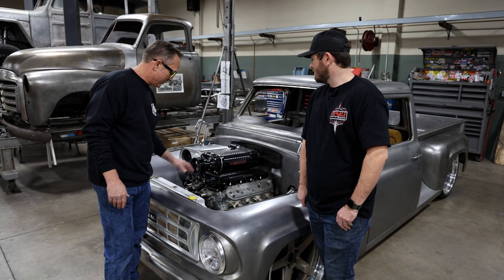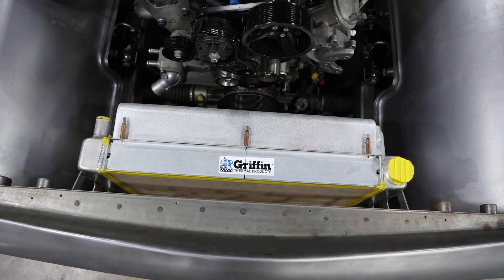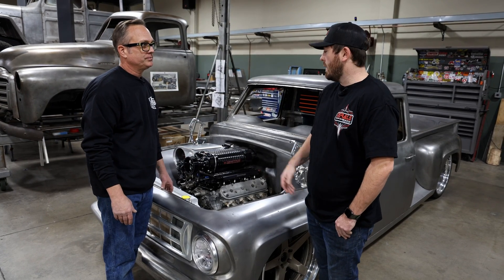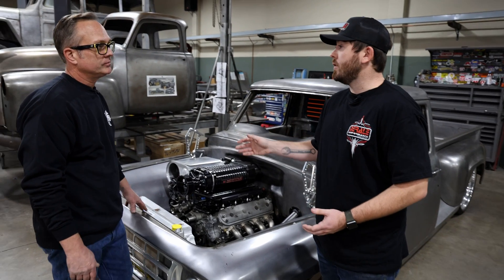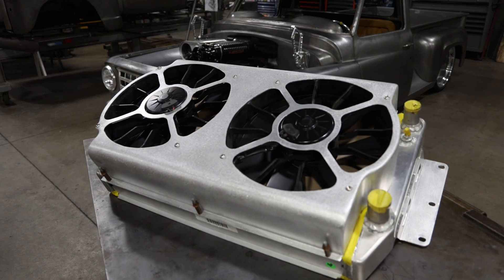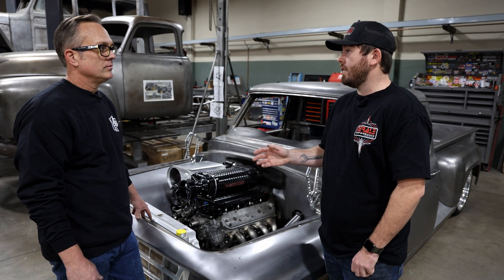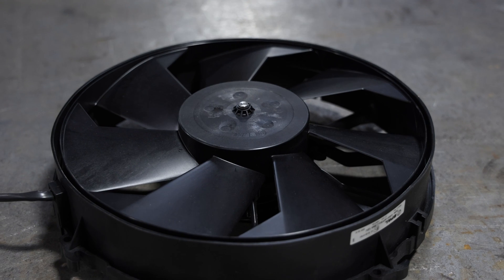We have the Whipple and a Griffin radiator and we're going to be producing a tremendous amount of heat, so we need a lot of CFMs. On a nice big radiator like this you have enough room to put two fans. If we can fit two of our 12-inch fans - like the 6924 that you're using - you're going to have about 2,000 CFM out of each fan. That fan is proprietary to us through SPAL, so it's high quality you can rely on.